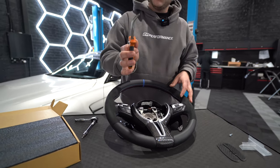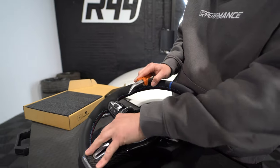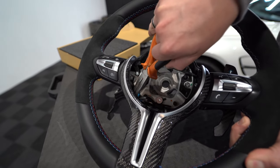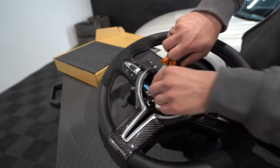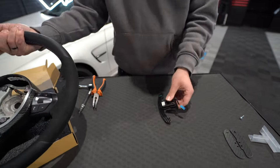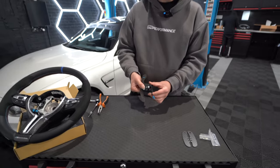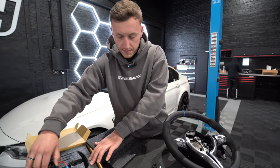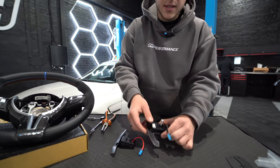Using some needle nose pliers — slightly angled ones — you want to reach down. You can undo some of the wiring in front of the paddle shifter connection to get better access. Go down and grab that clip by the black housing around it and pull it out. Then with your hands pull it apart and that's the old paddle out. These are a valuable piece, so you can sell them online to help fund your JQ paddles. Now let's put the new one next to the old one and show you the big difference.